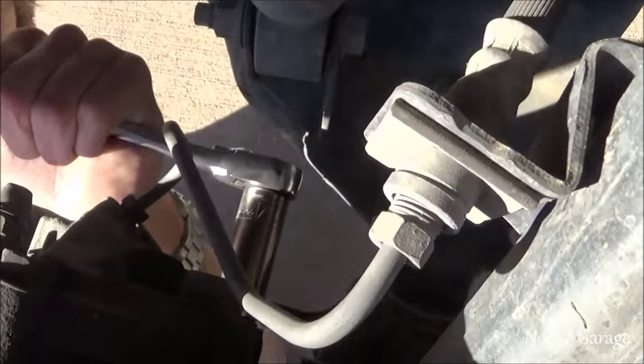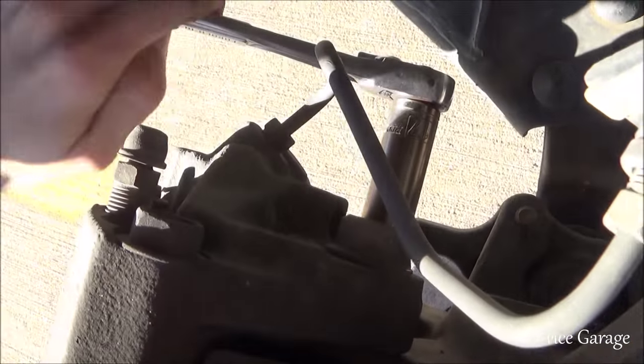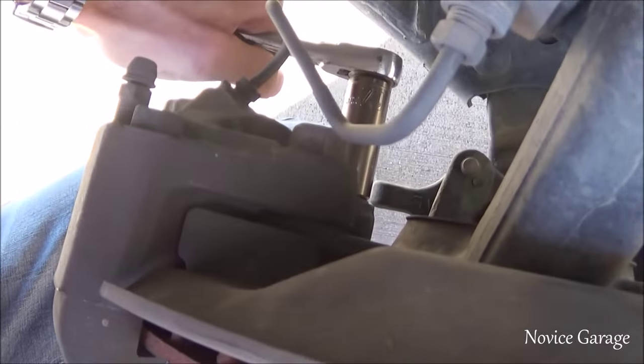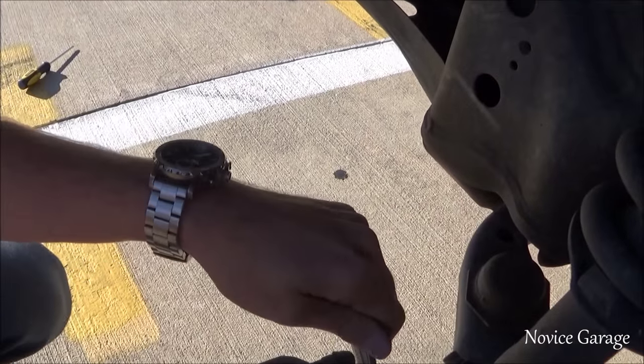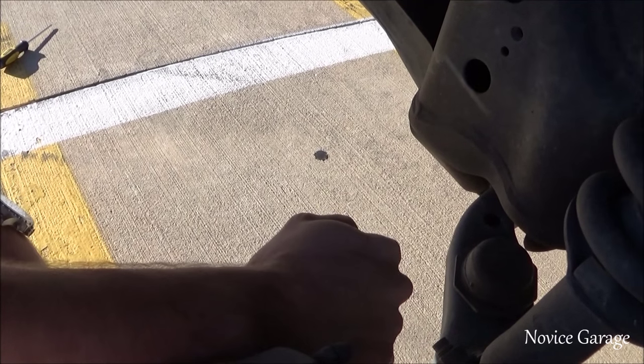To do this, you should only have to take off two bolts. There's only two bolts holding the caliper on there. I'm going to go ahead and take those off. We might have to take off more — I don't know yet. Is it moving? No, it doesn't. You're spinning it the wrong way — you're going clockwise.